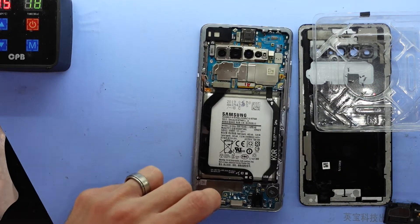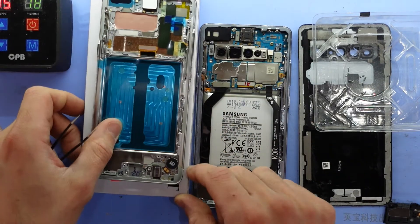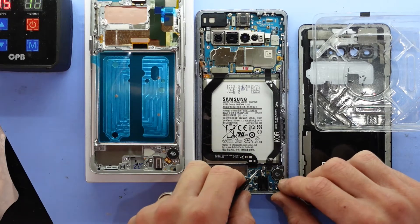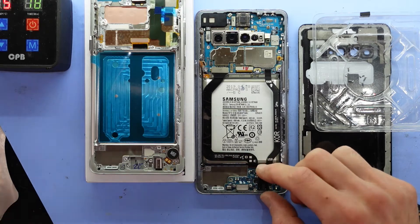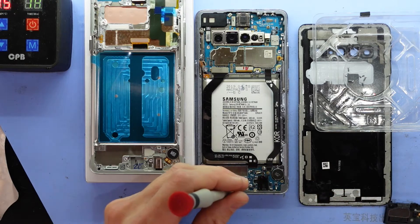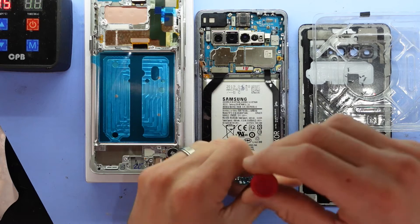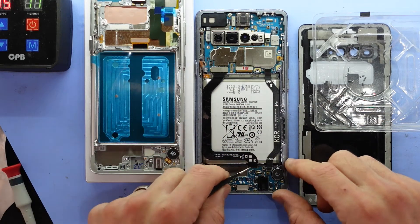We'll keep this on the heat but I'm going to bring along the new screen. I'll leave that all connected. Disconnect that one, disconnect the audio jack. I've got three screws on the charger board to take out. As you can see on the new one we don't need to move the vibrating motor — not sure if it has a different name nowadays but that's how I tend to remember it.